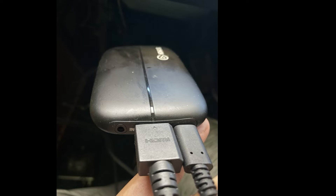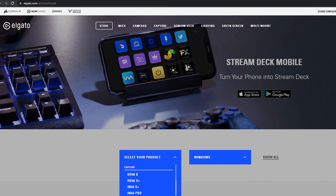The smaller cable to the right of the HDMI converter is the USB 3.0, which is plugged into the side that says 'In' on the Elgato HD60S — nothing is plugged into the side that says 'Out.' The HDMI gets plugged into this side of the Elgato HD60S and also into the console where you normally plug in the red, white, and yellow cables. The USB 3.0 is included with the Elgato HD60S and is also plugged into your PC tower. On the Elgato website, select whichever product you purchased — I have the HD60S personally, but they have a 4K version too — and select your operating system.